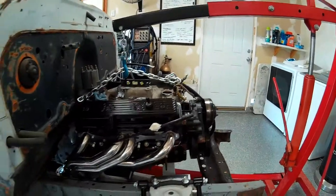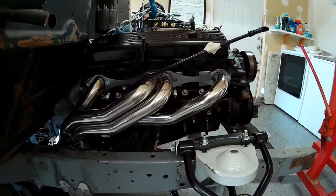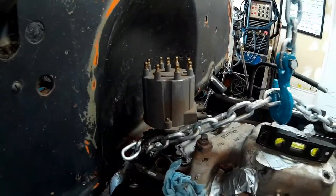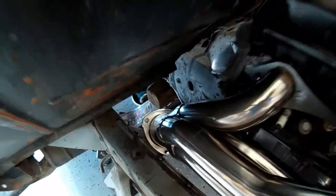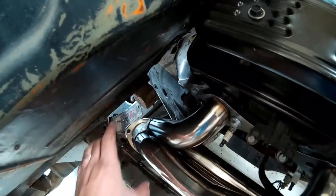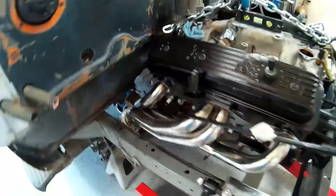This is going to be our engine height. Clearance considerations I had to make: distributor clearance - I've got probably an inch and a half behind that distributor, so that's awesome. Header clearance I've got at least a finger's width, so that's probably about three eighths of an inch. The collectors dump right where I wanted them to. That cross member is going to be gone, so the headers will dump down to a 45 which will run right along the frame rail perfectly.